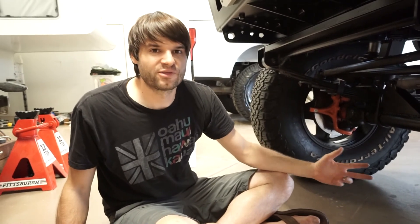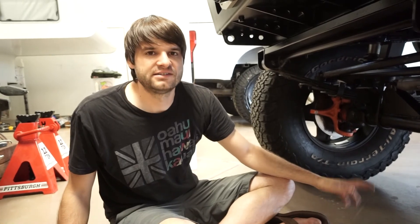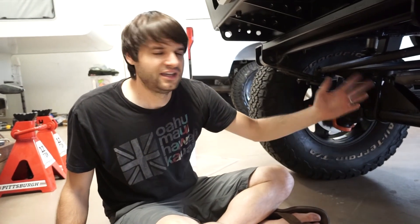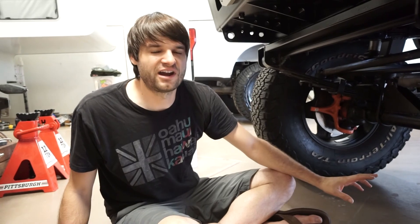The weak link is the tires — we're running 37-inch BFG KO2s which measure about 36 inches. I always prefer the weak link being the tires; if you're out on the trail you don't want to be pulling apart axles, you want the tires to break free first. That's been totally the case — it's just invincible. The RCV axles also don't bind up the way U-joints do, because the Rzeppa-style CV can be at full lock under full power without issue, delivering very smooth power.